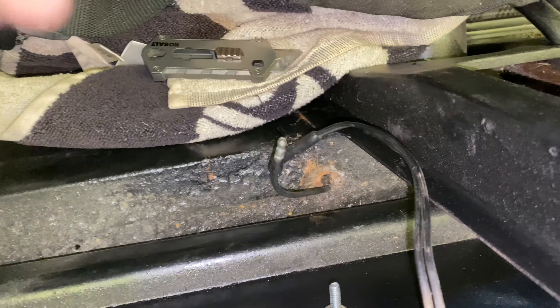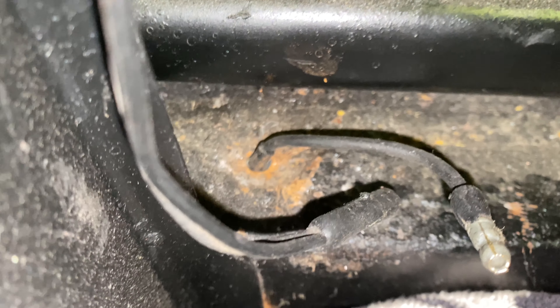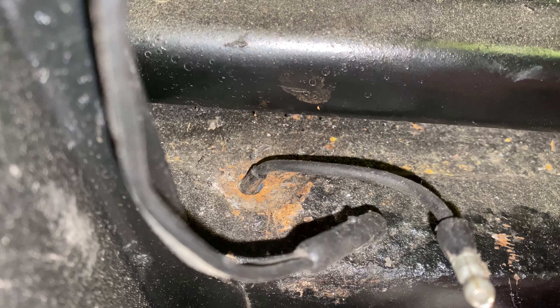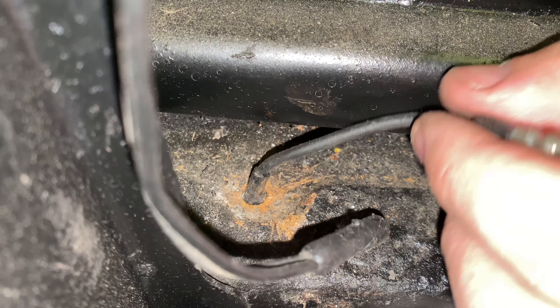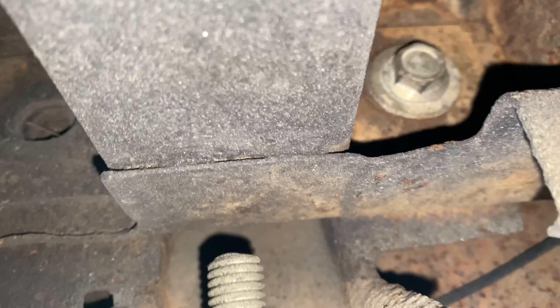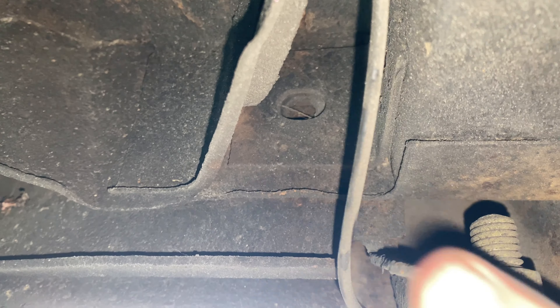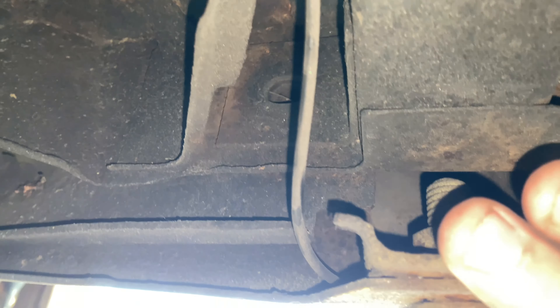If we're looking at the back of the car to take this bumper off, we're going to have to go inside the trunk. There are two bolts — this one's missing on this side, but we've got a bolt here. Coming along to the other side, same thing — and again, there's a bolt missing. I'm going to put a bolt back when I put this together. We've got to remove those bolts — usually four. And then the bumper will come off. But also, we've got to come in here and disconnect our light switch too.